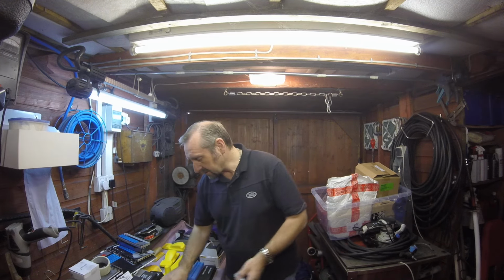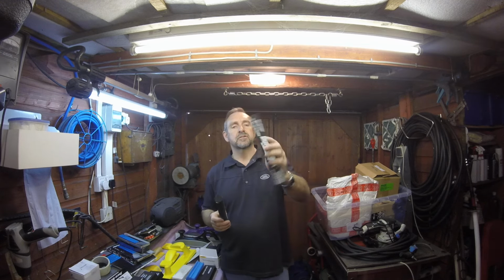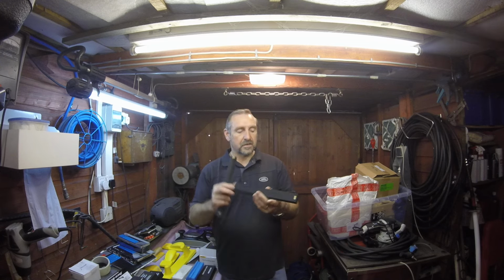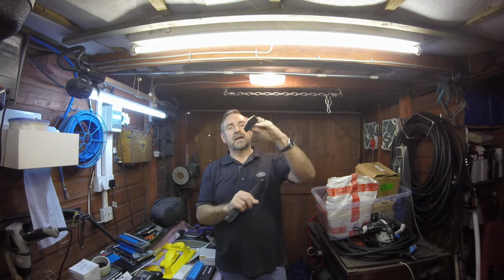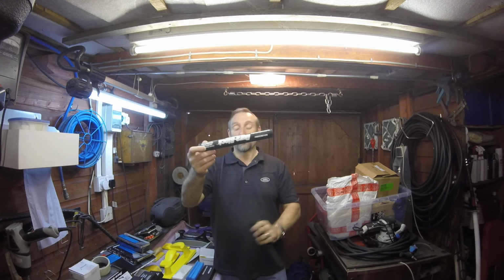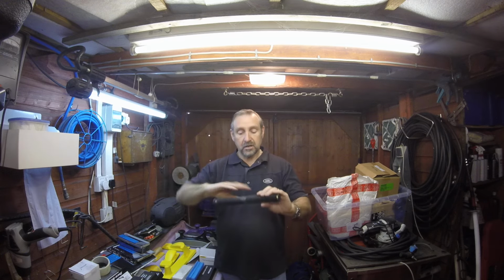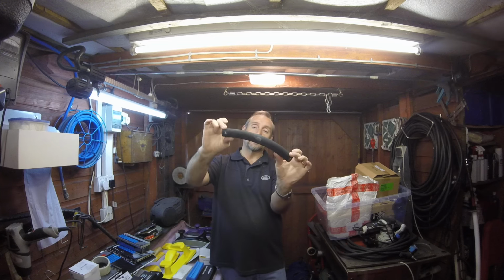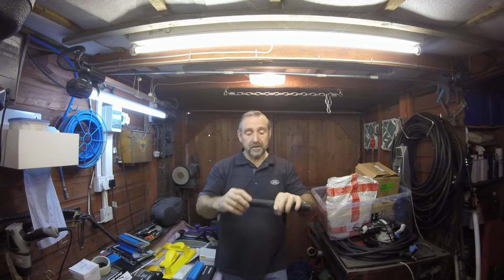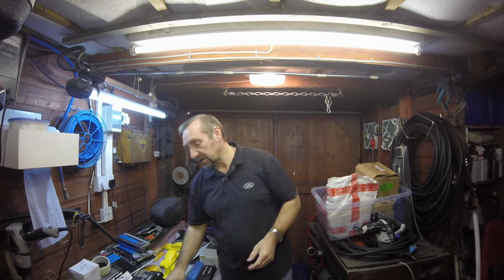In that Dura-Block kit as well, there's another couple of shaped blocks. So once again, choose a block to rub down the shape that you're looking to achieve. So if you're looking at a little step in a wing or a panel, that would actually work on both sides, keeping your edge sharp. A round block, if you have any curved sections, some concave sections that you wanted to wrap some paper around and maybe even twist and sand down the shape of a wheel arch or a flare on a front fender, something like that. Once again, choose a block that's going to make your shape.